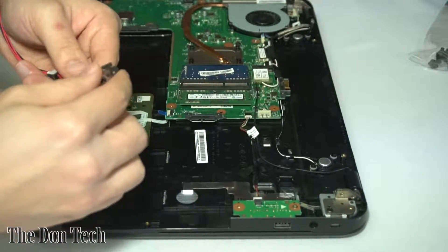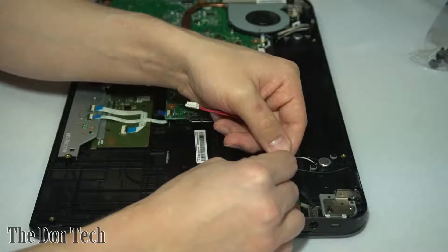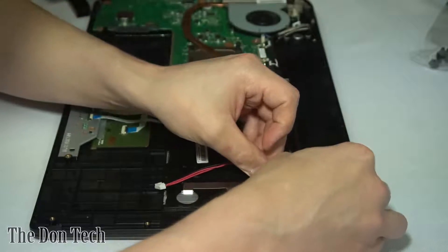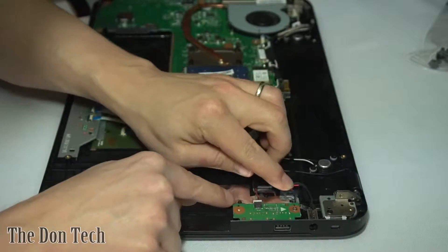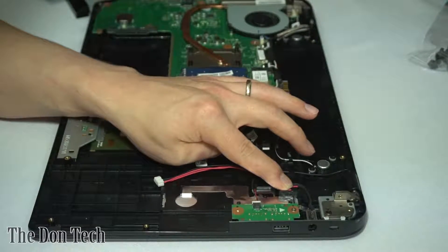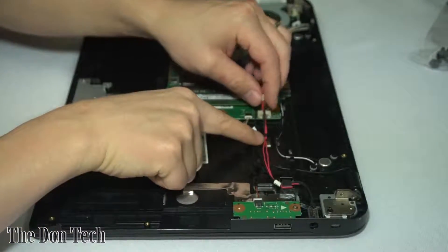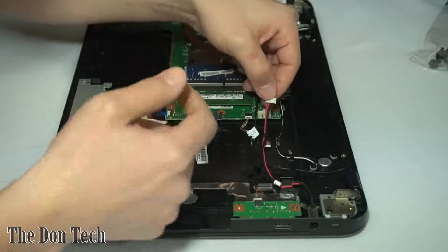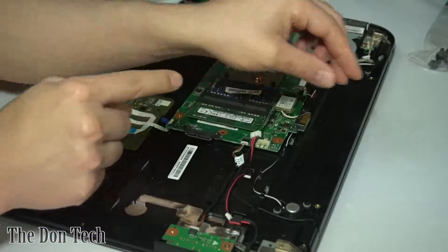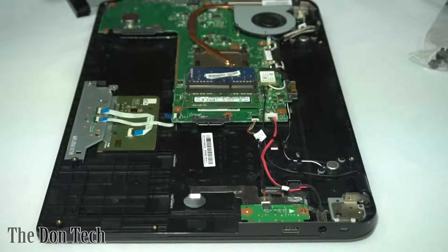To replace the DC jack, you just do the exact opposite of what you just did. Place the DC jack down and make sure it's going to go in the right orientation. DC jack done. I'm going to turn this over and get this little piece of plastic off for the stickiness. Rearrange the DC jack to fit for the cable and place that in — just hold it for a couple of seconds to make it secure. Follow the DC jack cable down through here; there are little notches right there for you to line the cable up with. Make sure you get the orientation correctly plugged in — there are two notches on the white side of the DC jack. Turn it over, line her up, and in she goes. Congratulations, you've replaced a DC jack — no soldering, no damage, no pain involved.